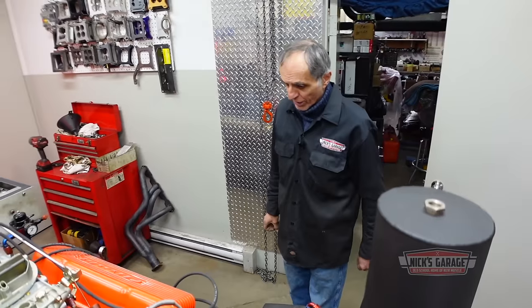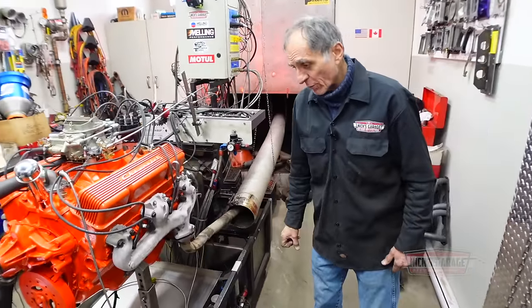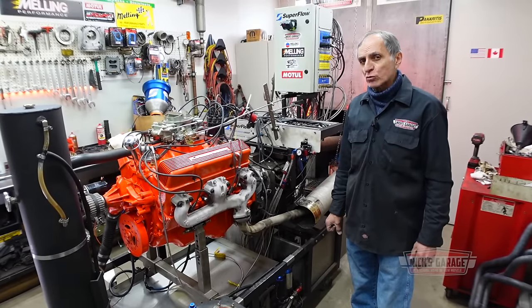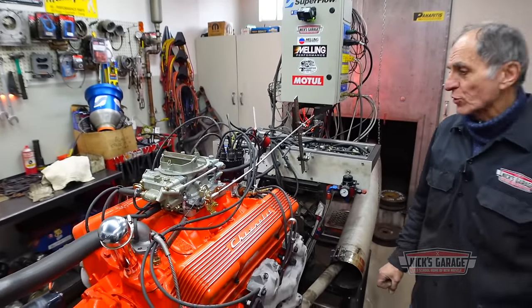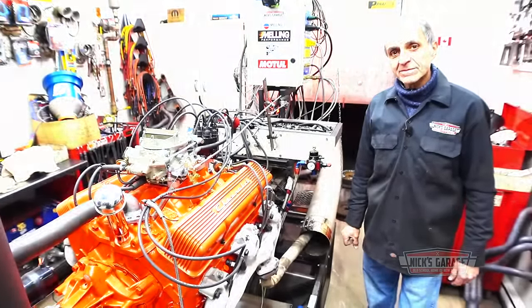We did a good valve job on it. We went 40 over pistons on it, flat top. He's got a little cam with a 480 lift, 232 duration on it. It's a hydraulic flat tappet with a two-plane high-rise intake manifold, a 650 vacuum secondaries carburetor, with a flamethrower distributor, like a Petronix setup. And I'm ready to get started.